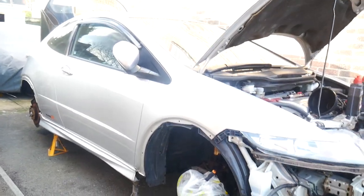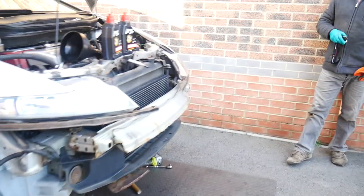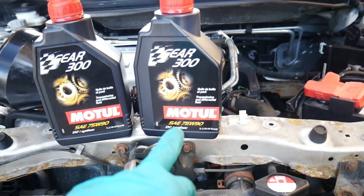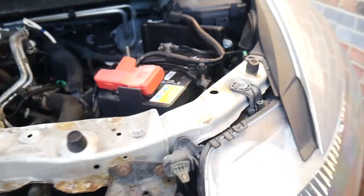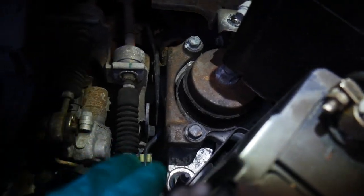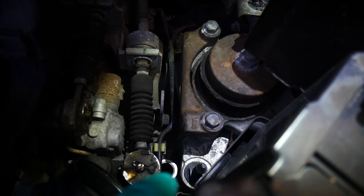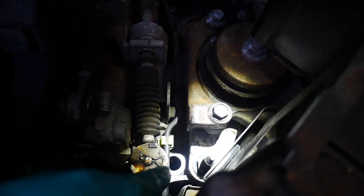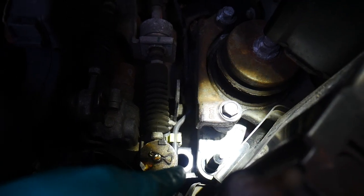It is up a tiny bit just for the axle stands and the engine side of things. That's all we're going to be using. It's all stable, seems good. What we're going to do is a nut that we're taking off just there, and you'll see it's open just here, right there. And actually, if I get close enough in a sec, you'll see the gears in there and a synchro as well. We're going to literally fill it up with this big funnel straight down to the gears. So factory say 1.9 litres in the gearbox.